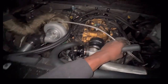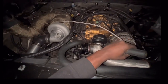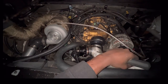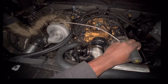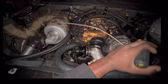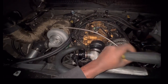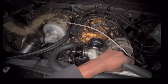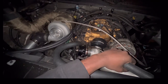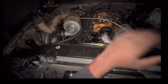I am working on the Tahoe, getting everything pretty much prepared — making sure everything is nice and tight for tomorrow because I will be dropping this truck off to my tuner. I did mention that I was on a base tune, so we're gonna see what magic he can do. I was having a misfire every time I go on boost. It sounded like popcorn, like da-da-da-da-da, coming in and out. I checked my spark plug wires and spark plugs and all that was perfectly fine.